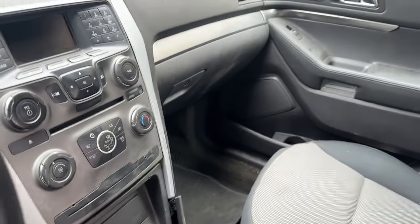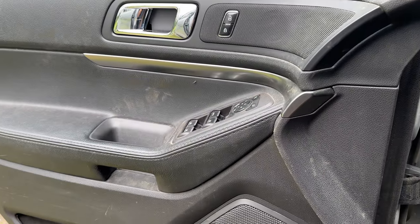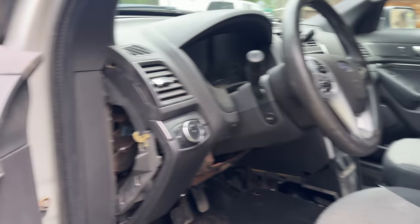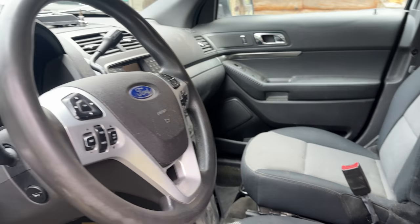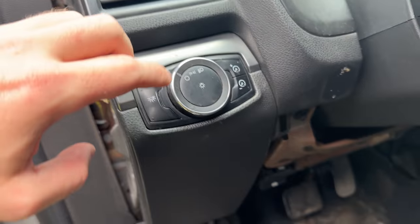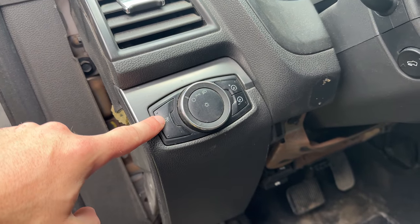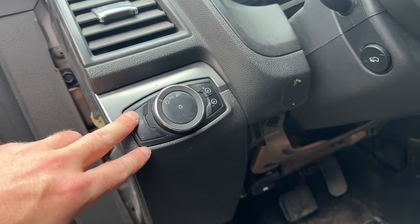The console and a lot of the door panels I got to replace these came from a 2013 Explorer Sport — same year. It came with all the interior lighting, the little lights under the center console. I'm going to get those all working and show a bypass for those. We'll also be upgrading to automatic headlights instead of manual ones, and we're going to try to get the fog lights working with LED lights, though that may or may not work.